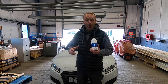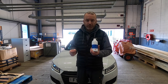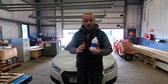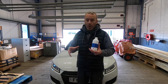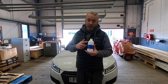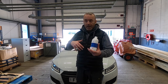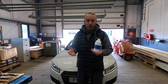For aesthetics, and to stop all those iron particles embedding into your alloy wheels, we're going to mix this up and make half a litre. I'm going to take one of the wheels off and tape up one side of the disc, treat it, then subject it to some citrus, some snow foam, some shampoo, and loads of water - then set the camera up on a fast mode to see what happens. Hopefully the untreated side develops that orange flash corrosion, and if the treatment is working, it will be reduced or clear.